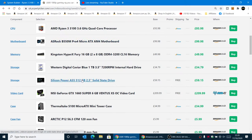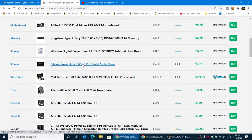You could then maybe double up the size of your SSD, or maybe convert that to a 1TB NVMe, which would on paper make the system look a lot more attractive, but realistically I think in performance it wouldn't be massively different. There isn't really much you can do with the 1660 Super as regards the next upgrade.